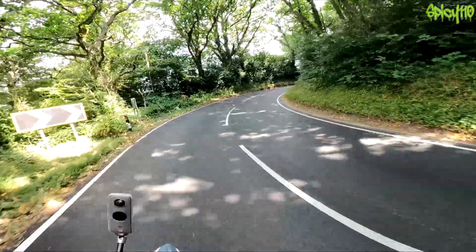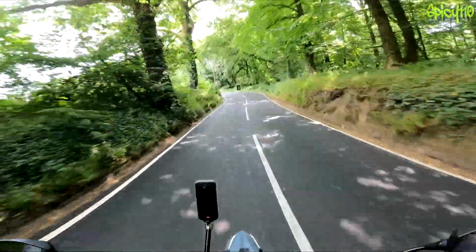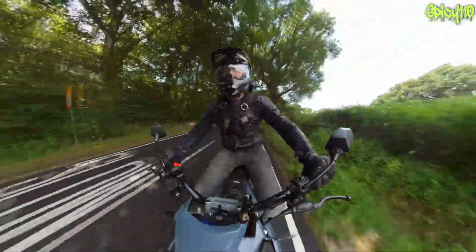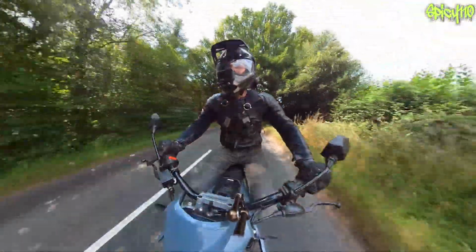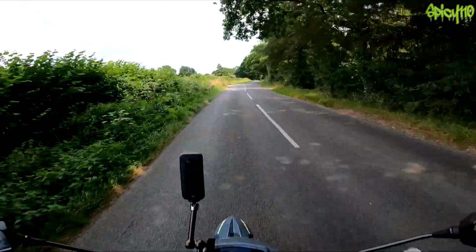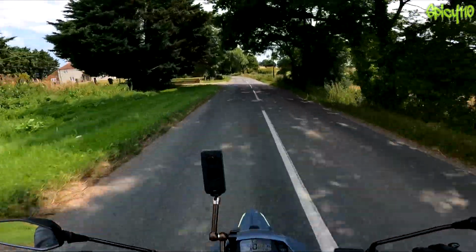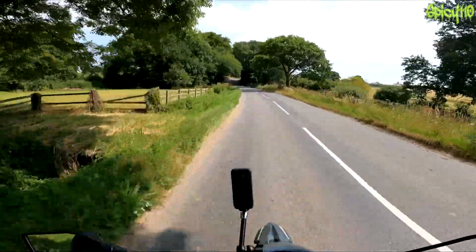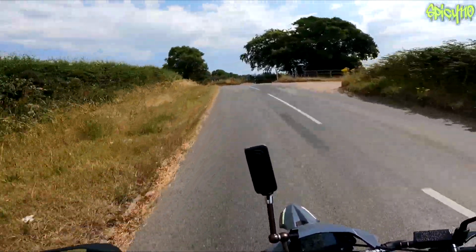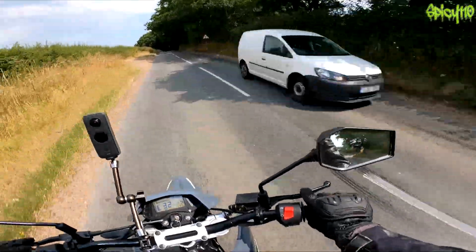Now, I can talk a little bit more about the gearing. If you haven't seen my other videos on this bike, I've got a first ride, and green laning, and a comparison between this and the Enduro version, the XE. Well, as I mentioned in a couple of those videos, the gearing on this is a little bit odd, and I couldn't really put my finger on why. And I've now sort of worked it out. What it is this. First gear is extremely short. Second gear, there is a big jump up, and then there's smaller jumps between second, third, fourth, and going upwards. The other oddity is the fact that you can put the bike from third gear to sixth gear, not increase the speed, and be doing a similar amount of revs.